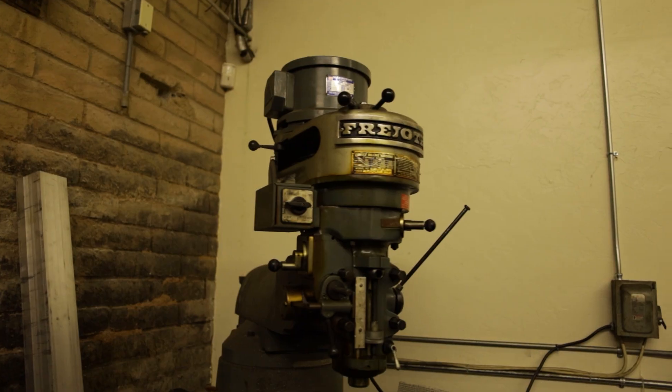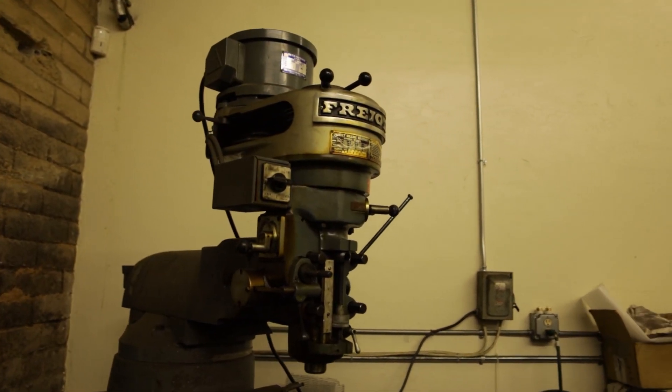We're going to get more into doing piston domes because there's a need for that. What we do is take a laser scan of a cylinder head combustion chamber, and that becomes the top of a piston. I can make a couple of adjustments for clearances, and with a little bit of programming we can make an exact duplicate of that combustion chamber on top of a piston. We get maximum compression, because the guys we're building this for are running pretty much all-out race cars — they want the maximum they can get.